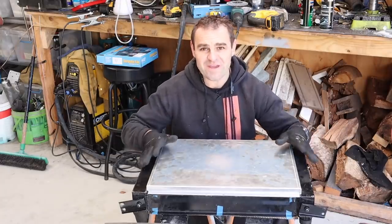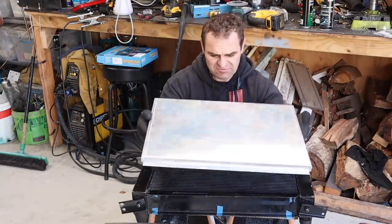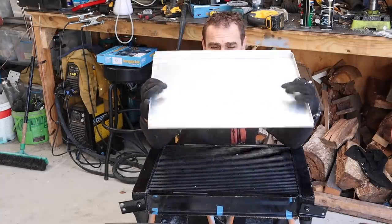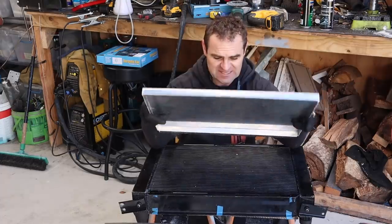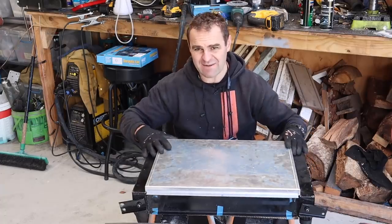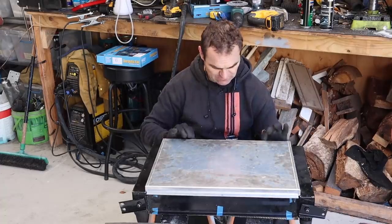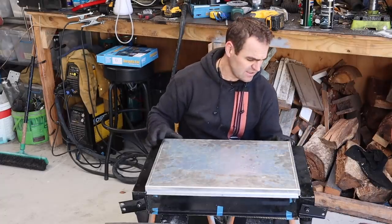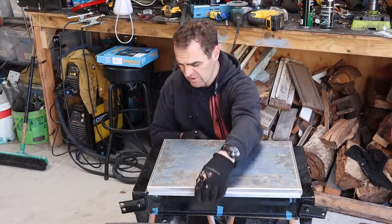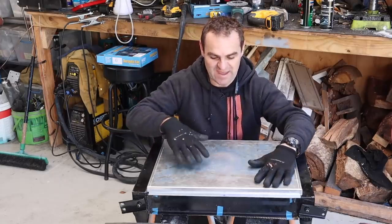All right, a bit of cutting and folding, and we have my radiator fan shroud. This has got just enough depth to allow airflow, and I'm going to mount my fans to this. I had to do a little bit of trimming just to get it to sit onto the radiator, as the radiator is handmade, trying to make sure everything is square and sits perfectly straight. That is going to look quite nice. Now I'm going to attach it top and bottom, so I'm going to have to put some of my favorite riv nuts in. But before I do that, I'm going to mount the fans up.